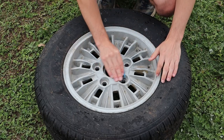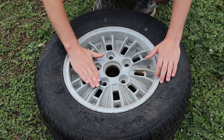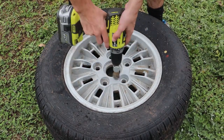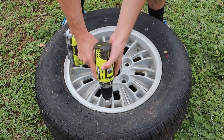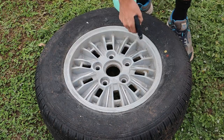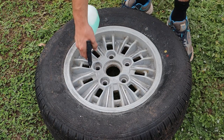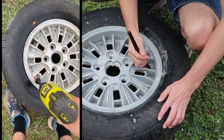The only photos I could find online of the SD1 Rover in the Triton green colour showed the rims with a metallic gold colour. I did check this multiple times as I thought it was a bit of a weird colour for the rims. Anyway, let's start by taking off the roughness and the rust with some sandpaper and a wire wheel. I sprayed the rim down with some soapy water and agitated with a brush — a top tip is locking the brush into a drill and just spinning it, as it cleans out everything in a hurry.